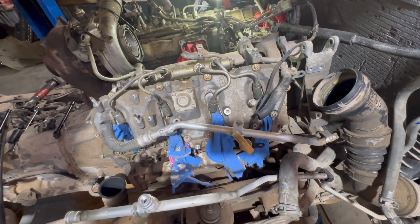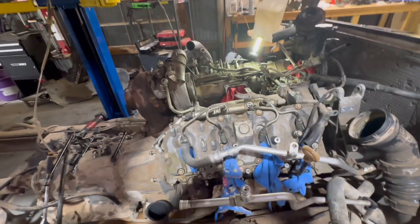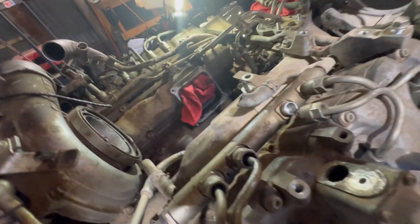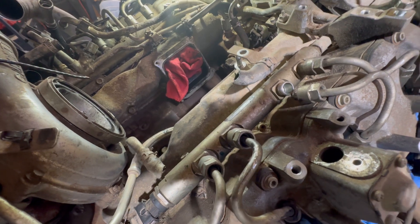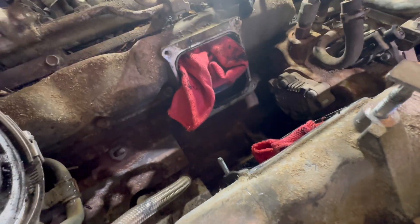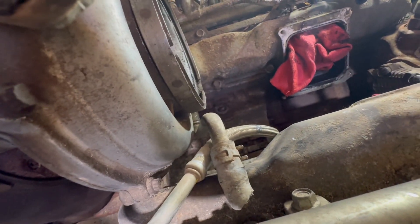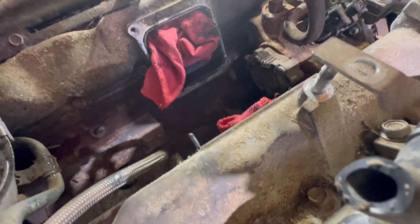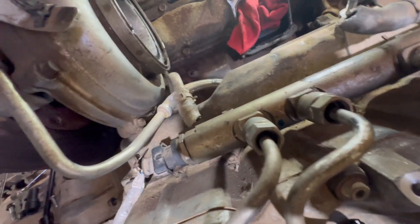All right guys, last video for this section. We're breaking it down into parts. When you're doing the cab-off, it's 10 times easier — you don't have to fight the 10-millimeter bolts near the turbo housing. You can sometimes thread the top ones out with pliers. To remove the turbo: loosen it up, take the banjo off, cut that line since it was already ripped. Three 17-millimeter bolts — you can access one from the side, come down through the corner with a wobble socket.